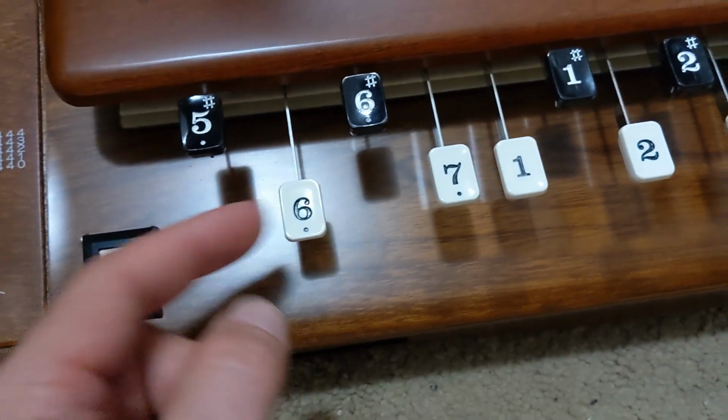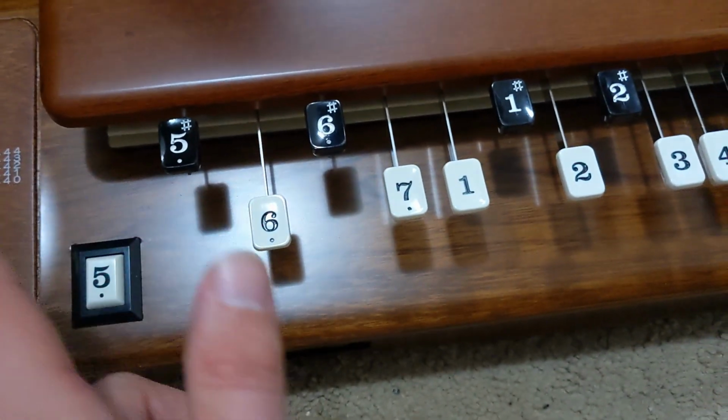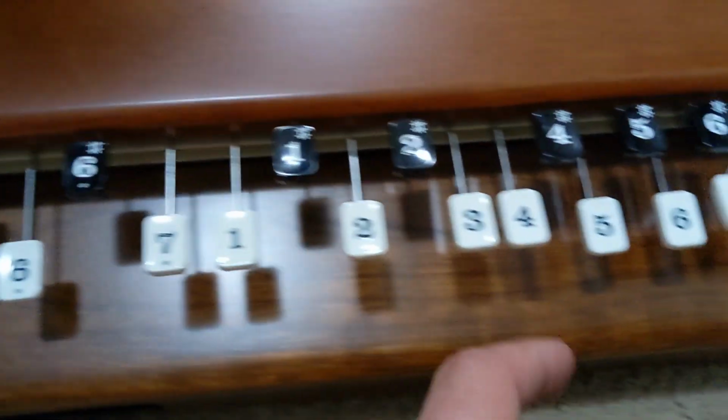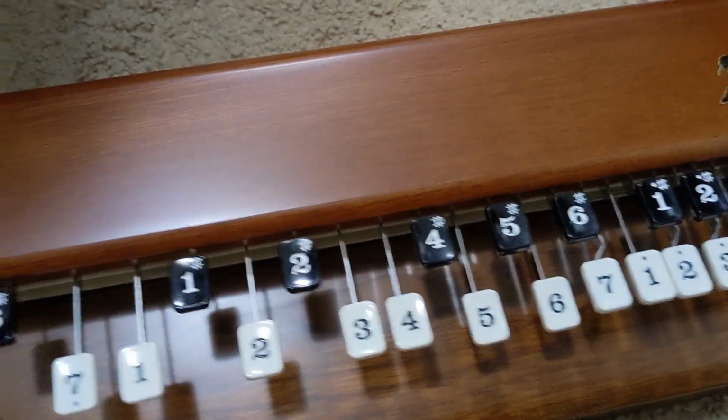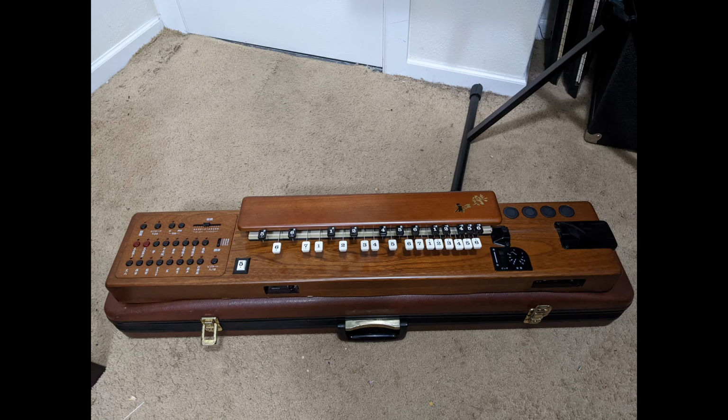So today I've got a TES-100, the Suzuki Waraku. You can see here that I have some keys which don't spring back. They're definitely broken, so I want to go ahead and show you how to repair them. You'll also notice it has this top portion that we need to get under, but we're going to access that through the back panel.